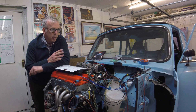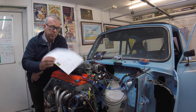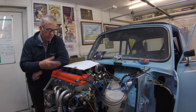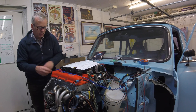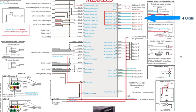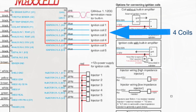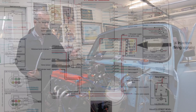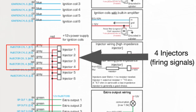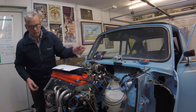In terms of the wiring, it's very clear really. There's a wiring diagram — I'll do a cutaway shot to this so you can see in a bit more detail. I've just been working through this and the cables are all colour-coded. You have a set of cables colour-coded blue for coils — four in the Nissan's case, though it is wired for up to six. The injectors are all colour-coded grey, sensors are brown, and blacks are common.